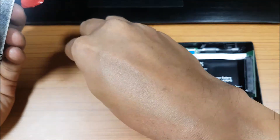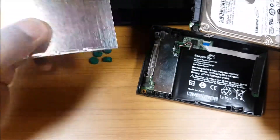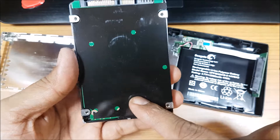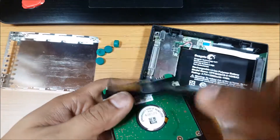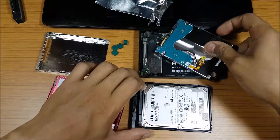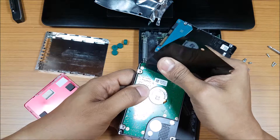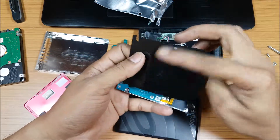There are four tabs on the corners with screws to remove. Slide it out — that's the hard drive, a 1TB drive. One important thing to remember: this drive has a plastic film on it because the chassis is metal, to prevent shorting. You'll have to remove this film and put it onto the new hard drive. If you don't do that, the drive might short and go bad. Now take the other hard drive and slowly align it — don't put too much force.